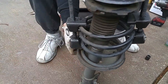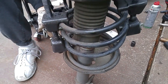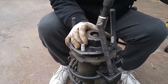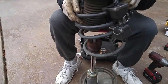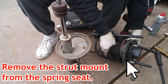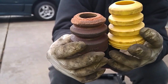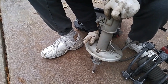If you notice the base of the strut — the spring is moving around — that means there's no more tension between the base of the strut and the strut mount. So now we can remove the strut nut up here, and the whole assembly should just come right off. Here's the old bump stopper. Let's compare it to a new one — see how much it's worn out? There's good resistance going down.